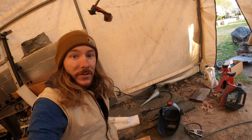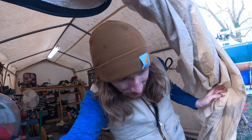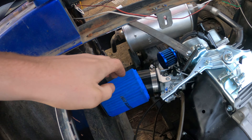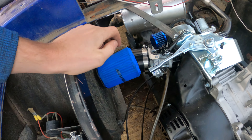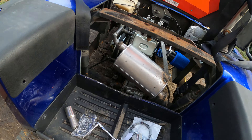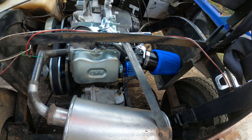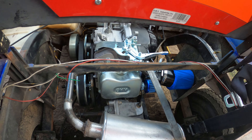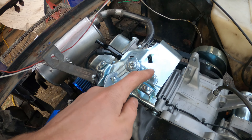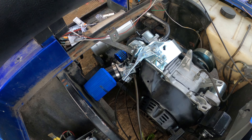Now that the exhaust is cooling down, it's time to work on making the thing run better. Turns out I didn't have to take the motor out to put the air boot on — there's just a little bit of clearance and I snuck it up in there. Everything's bolted up now. Got the muffler all hooked up, crankcase vent, little filter — it's looking good. I even got some throttle return springs on it, got one as a backup just in case, and she snaps back good.